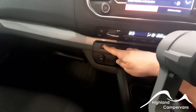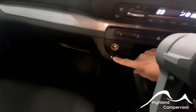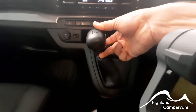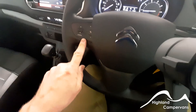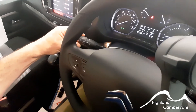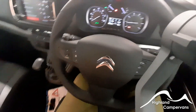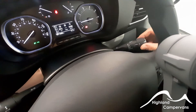Child locks can be activated on the sliding doors. You can lock the vehicle in its entirety from that switch. You have your hazard light switch located in the middle, a 12-volt socket and USB — the USB being connected to the DAB unit. Reverse is up on the central column and then over and back to engage. Steering wheel controls are connected to the stereo for volume and configuration, as well as your mobile phone. The left-hand stalk controls your automatic lights, dip and main beam, and front or rear fog lights, as well as indicators. The right-hand stalk handles all wiper controls for intermittent and automatic functions.